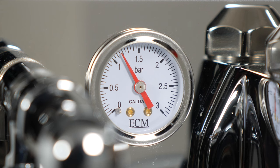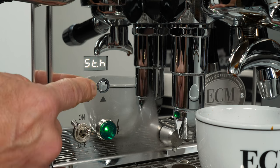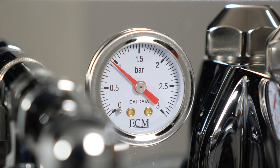Watch the pressure gauge — we recommend at least 1.2 bar on the gauge for steaming milk. Once the extraction is complete, pressing the down button again cancels extra heating immediately. Or do nothing and extra heating stops automatically after about three minutes and the machine cools down to the original T1 temperature setting while maintaining the pressure range from 0.7 to 1.5 bar.